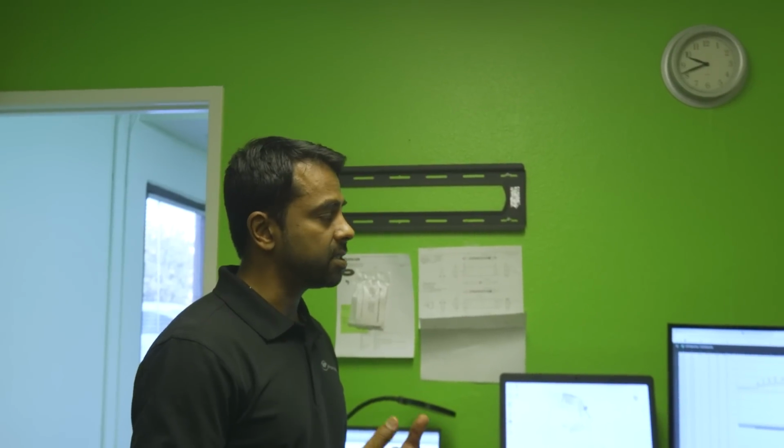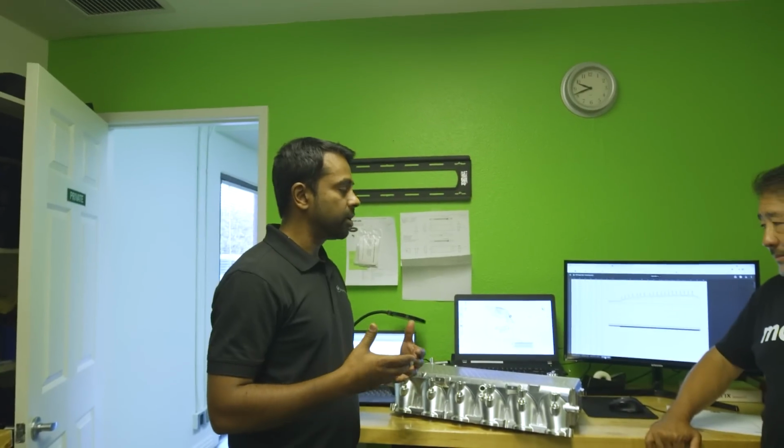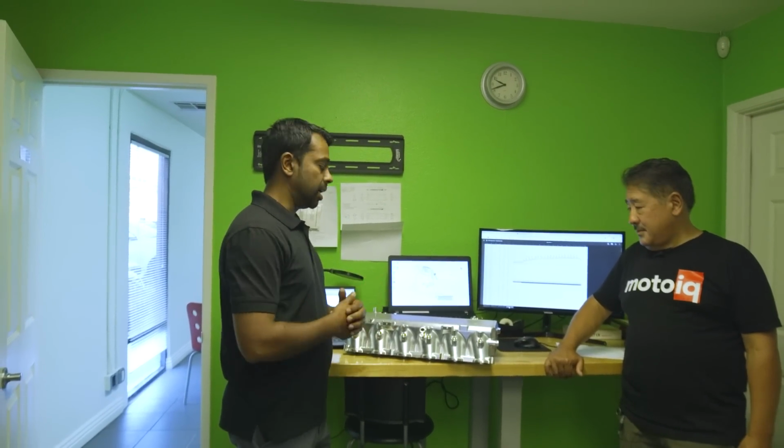One thing that was really important for us and for your results and data collection was just consistency of the conditions. So with the dynojet that we used, the fuel wasn't changed in the car, and all the conditions, even the temperatures, were fairly close between the testing of the stock versus the billet piece, and were all consistent.